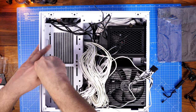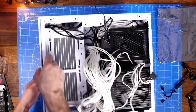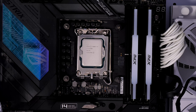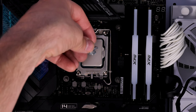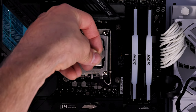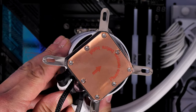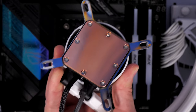Once positioned, go to the back of the case to screw in the small screws into the radiator to hold it in place. Hold the front of the radiator and screw in two screws, then lay the case flat and screw in the rest. Leave screws slightly loose so you can reposition the radiator up or down as needed once the system is fully set up, then tighten everything. Now the thermal paste — yes, people will say I use too much, but I'll show the thermal tests at the end.